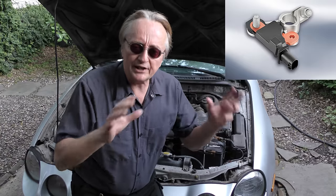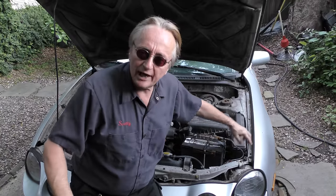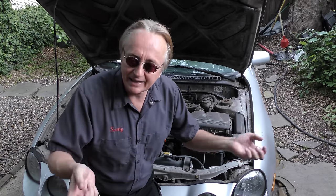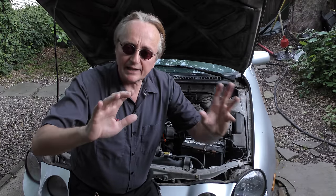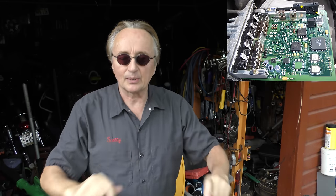Now, in many modern cars, there's a sensor called the electronic battery sensor. It's on the negative terminal going to the frame and engine too. It grounds the whole vehicle, the engine, transmission, and the body of the car. This electronic sensor sends feedback information to the computer about the battery, voltage, and temperature, so the computer can control the charging correctly.